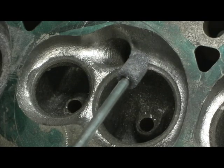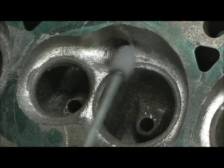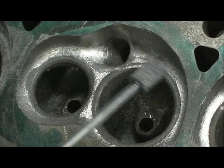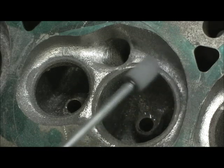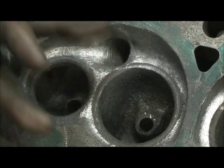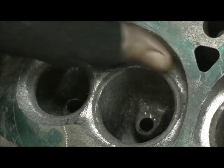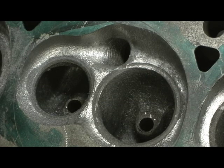This is probably the most intense part of what you're doing. If I had to describe what it is I'm doing, I'd call it a bounce — because that's all it is. The problem is if you put too much pressure you dig in here, you dig in there. But you've got to knock that edge off in order for that 30-degree angle to roll off in and there be no machinist ridge.